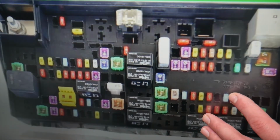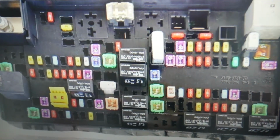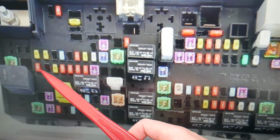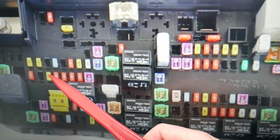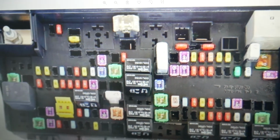By the way, make sure you stay till the end. We want to give you a quick advice so you don't end up being stuck in the middle of nowhere like it happened to us. In that row of fuses, that's 72, 3, 4, 5, 6, so 72, 3, 4, 5, 6, 77. Fuse number 77 will be the one that you will need to check.